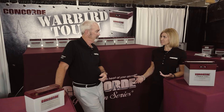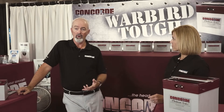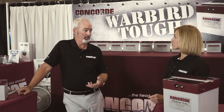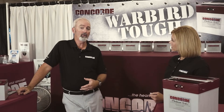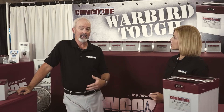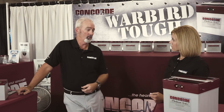Is there anything else that we need to consider in charging a battery? You need to make sure that the equipment is properly adjusted, whether it's a maintainer or a bench unit, to make sure that the proper output voltage is going to the batteries. What happens if it's not correct? If it's too low, you're not going to get the battery fully charged and sulfation is going to begin. If it's too high, then you're going to dry out the mats in the AGM batteries, and that's going to shorten the life as well.